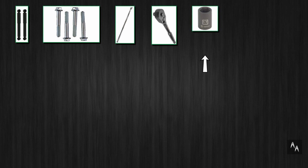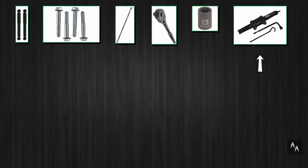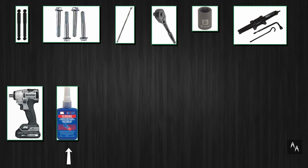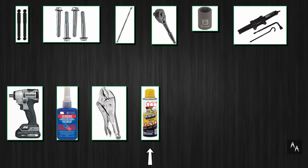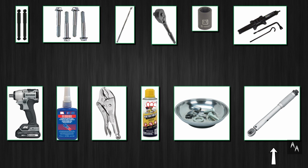Here's what you need to be able to complete this. New parts, part numbers in the description, new bolts, two for each side, a breaker bar, a half-inch ratchet, a 17mm socket, car jack for leveling the lower control arm to remove the old dampers and install the new ones. You might also need or just want to use an impact wrench to speed up the process, threadlocker to apply to the bolts when reassembling, vise grips in case the welded nut for the lower bolt snaps off the lower control arm, just like mine did, penetrating oil, magnetic tray, torque wrench if you want to properly torque your fasteners. Alright, let's get to it!